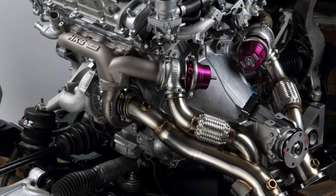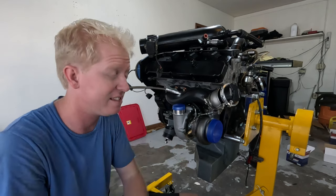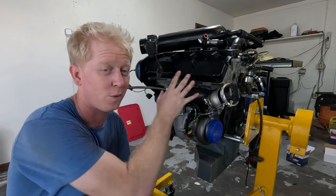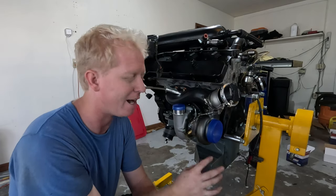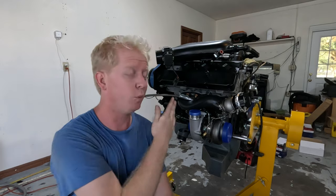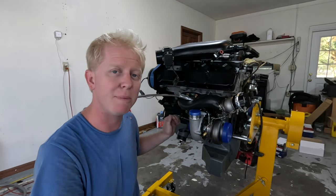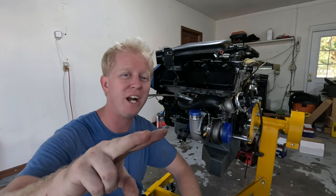Seeing that GTR made me realize that if they can do it in that car, there's no reason we shouldn't be able to do it in the 300ZX. I 110% suggest this turbo setup — it should be well capable of a thousand horsepower, and it's absolutely game changing for this car and the VG30 platform. Now instead of having to pull the motor to get the turbos out, it's one V-band bolt and the turbo drops out. I have other videos completely assembling this motor from the rod bearings up through porting the heads and installing cams. This is a fully built VG30 — the only thing missing is billet main caps. I'm still on the factory main girdle. That's going to do it for this video — hope you guys enjoyed it, we'll see you next time.